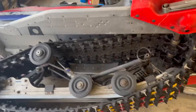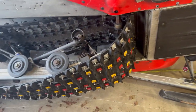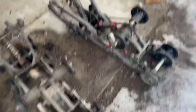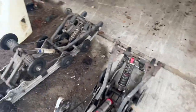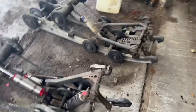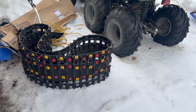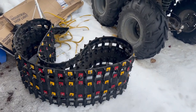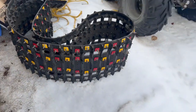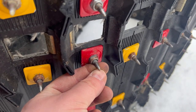Anyone need an X10 skid that was set up for ice? Same with the track — anyone want to buy it? I wish these were trail studs, I would've just left it on there. Video update — got the Pro X skid, 121, got the X10 that was set up for ice removed. There's a very slight difference in height there. Got this track pulled — it had four picks per bar. Unfortunately I wish these were trail studs, but they're not. You can run it on the trail but they won't last very long.